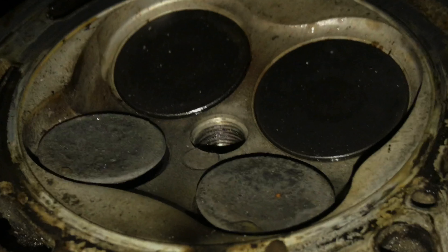There's the bottom of the head gasket, kind of torn. Oh no. So around those is, you know, where your water goes. And if you have a head gasket leak, you can go into the cylinders, or the exhaust gases can go out into the water, into your radiator. But look at those — cracked, smashed, pulverized, obliterated. Toasted.